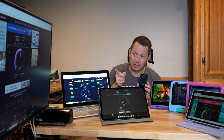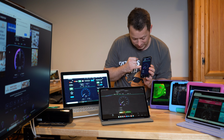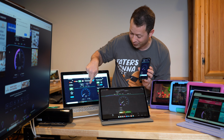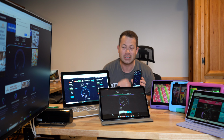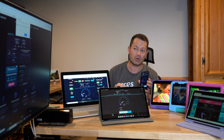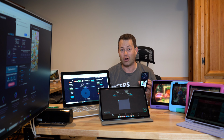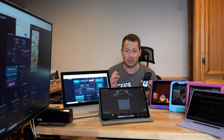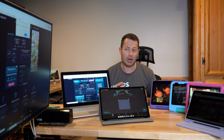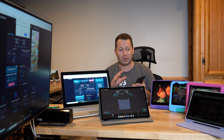And now that one started doing upload first, so it went up to 25, but now these other ones are going to start uploading. See, this one's only getting 2. This one's getting only fractional. This one's getting 2. Because that one started first, it got a lot of bandwidth, and then it slowed down to about 14 towards the end. But obviously, when they're all asking for the bandwidth, they can't all get it because they all have to get shoved through that single ISP, which I had about 30 or 33, I think, total upload. So in theory, if I add up these, it should add up to that. But let me break down these numbers and make it clear to see what kind of speeds we got across all these devices.